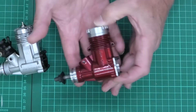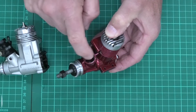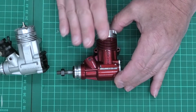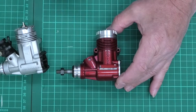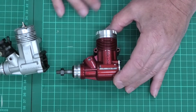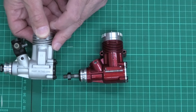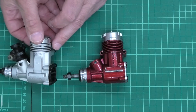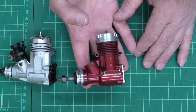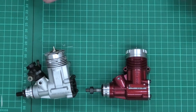This was a complete redesign and again we've got an even bigger spigot on the carb going into the crankcase to get a lot more air travelling through the engine. This redesign surely came with an increase in brake horsepower — a lot more power, making it a more versatile engine. But it did come at a cost: the Mark 1 and 2 came in at 255 grams with the exhaust, whereas the Mark 3 is almost 100 grams heavier at 340 grams — quite a significant weight increase.